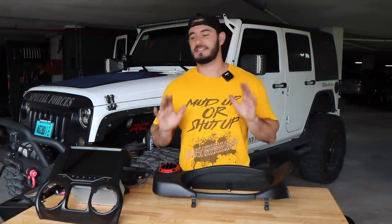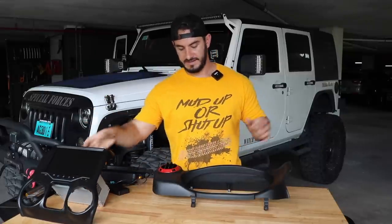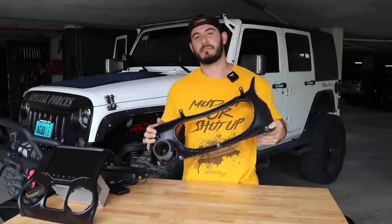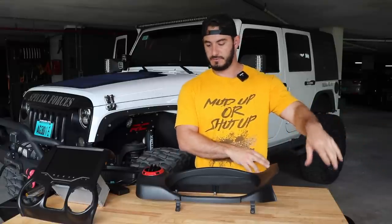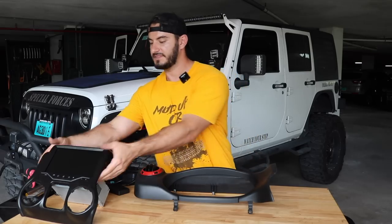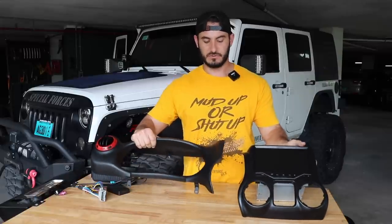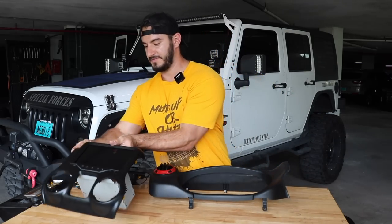The installation for the K1 is pretty easy. Everything on the back is plug-and-play and you get all the wiring harnesses that you're going to need. The only difficult part is the dash itself — you're going to need to make a cut, as you can see here. This is the dash that's behind the instrument cluster, held in by two 7-millimeter bolts and some clips. It'll simply pop right out after you take the screws off. You need to take this off because it's one entire piece including the radio housing, which probably has some 7-millimeter bolts on it. Unfortunately I did this two years ago so I don't have the other piece to show you. But the K1, after you cut the dash, is going to line up seamlessly and cover that. You're going to want to follow that line and make that cut with either a blade or a Dremel. Once that's done, we can go back into the Jeep and start the installation.